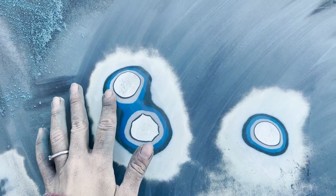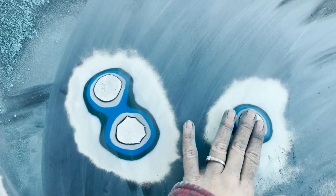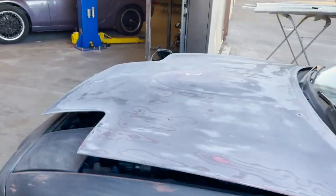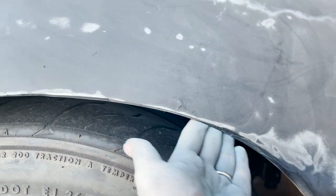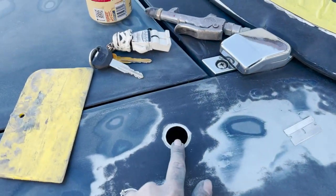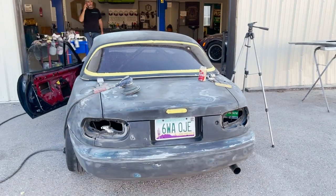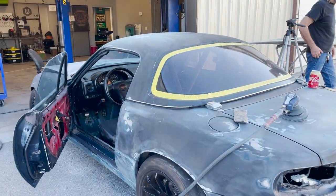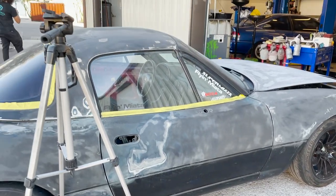There were a few little spider cracks up here on the hard top and I'm sanding them down. It is down to the fiberglass, so we're going to have to Bondo over these little ones because they are divoting. The other stuff we have to Bondo or fix is this wheel well fender which is all jagged — something happened to it, I'm assuming they tried to roll it. And of course that antenna hole will have to be welded over and possibly Bondo'd. The texture part of the passenger side still needs to be finished besides the A pillar.